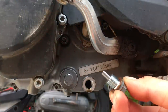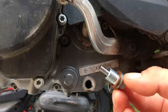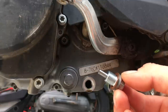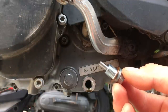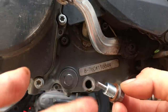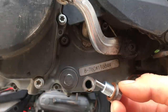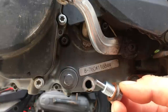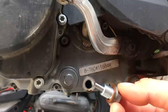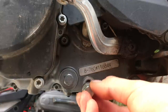Here I have my nice clean drain plug. They are magnetic on KTMs — I've always installed magnetic drain plugs in all my Japanese bikes too; it's one of the first things I buy. It just helps pull the shavings out of the engine. Those metal flakes I was pulling out from the screen — another indication that it's not like a blown transmission gear — is that transmission gears are made of steel and they would be stuck all over the magnetic plug. When I pulled it out it really didn't look that bad, just some very fine, almost fur-like tiny steel shavings. It's just clutch plates from me abusing the clutch, maybe parts of the basket too, which is totally common.